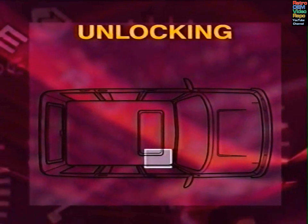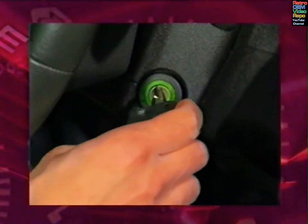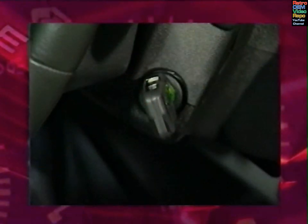All those instructions take place within the BeCM, but messages must be sent to other systems in the vehicle. A code is sent to disarm the battery backup sounder. Having entered the vehicle and inserted the key, the ignition is switched on. The engine management system is now remobilized.